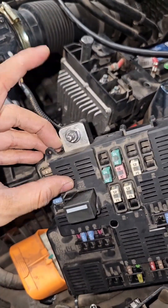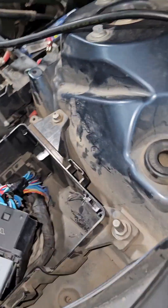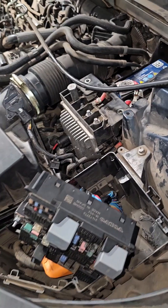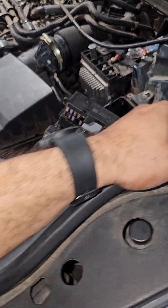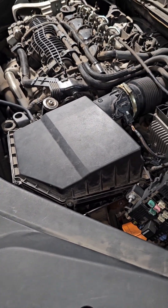If you have a loose bolt over here, that's going to cause all sorts of problems. You will have issues with switching on the relays and the generic scan tools are not going to throw any fault codes — they are going to show you very weird faults and misguide you. You need Vida.